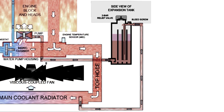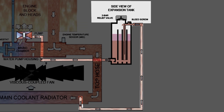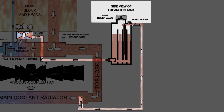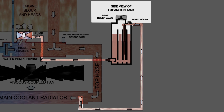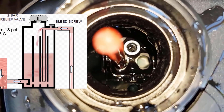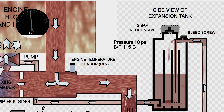The next thing it does, and just as important, is it's a bleeding system. It continually separates air from the coolant by taking a bleed line off the top of the radiator, which is meant to be the highest point of the cooling system — though as I showed in the cooling system series, the heater system is actually higher. For the sake of the engine that's the highest point, and that's where any air will accumulate. The system continually circulates coolant through the expansion tank: it comes in from the top of the radiator through the bleed line into the top of the expansion tank, and exits at the bottom which feeds the water pump.